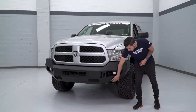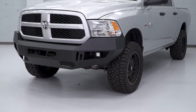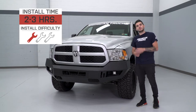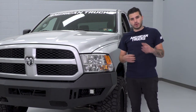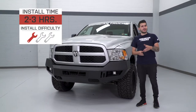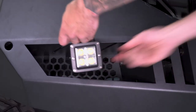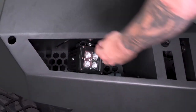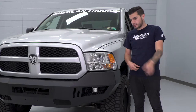It does give you a nice bump in ground clearance at the front end and a slightly higher approach angle on the side, so if you are doing some off-roading this will definitely help. The installation gets one out of three wrenches on our difficulty meter. You absolutely will need a helping hand — it's a big bumper made of full steel, so it is pretty heavy. I also used a couple of jack stands to hold it up while tightening down the bolts. From start to finish, expect two, maybe three hours at the most. The LED fog light installation is very simple — there's a plug-and-play harness, just bolt it to your battery and plug straight into the lights. No wiring, no cutting, no drilling required.